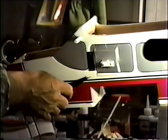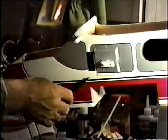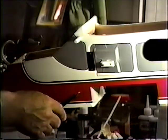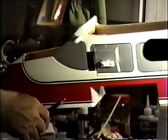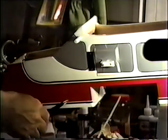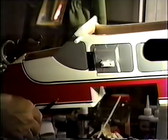So I just shoved that inner yellow nylon part down into here and then made a, well, it's a fairly short bend, but it's nothing that the cable couldn't handle, and ran it along, not completely to the bottom, but almost to the bottom up here to the firewall, bored my new hole like I showed you a minute ago, and made it big enough to where this ball link would not catch on the edge of it.